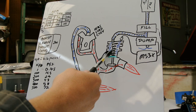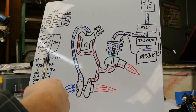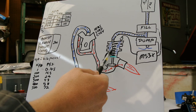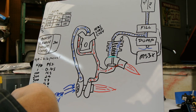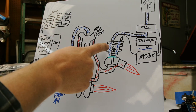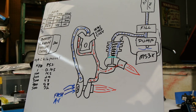How much kPa we're putting in here to help the spring out. And I say 310 on the dome overall, how much boost overall we're running, we're putting 310 kPa in here. And that's probably about it. Those are just those 2 simple ways that I use the dome control in Megasquirt. And what dome control is just controlling the amount of air in the dome of the wastegate. And you drop it down to launch at a specific boost, and then you let it ramp back in. And if you want to play with slowing down the ramp, you use the boost delay.